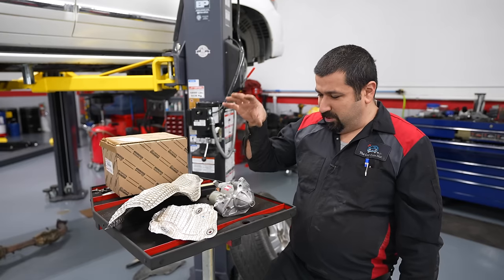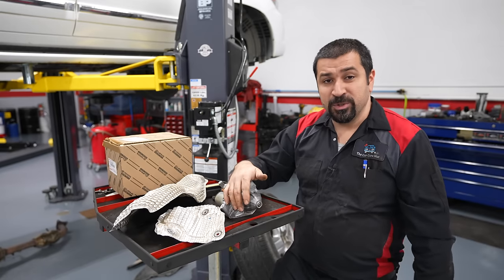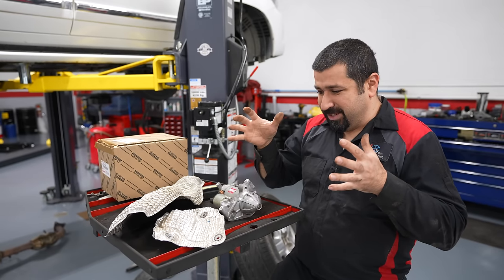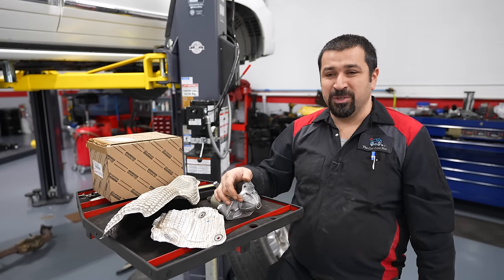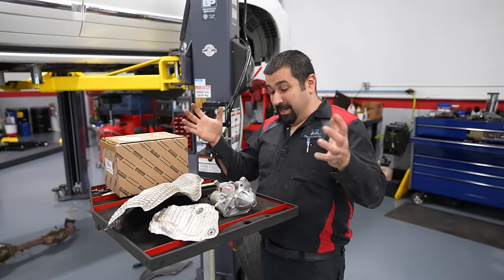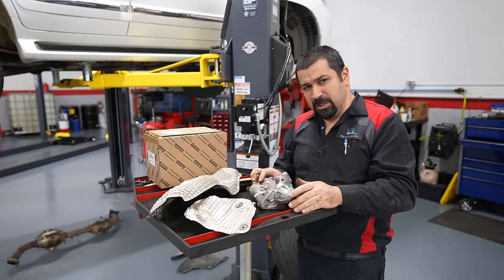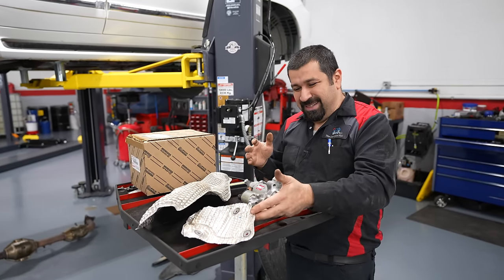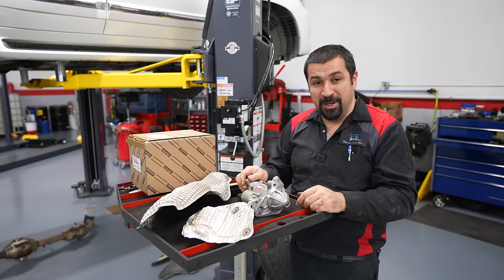This is possibly the worst job you will do on a V8 — aggravation-wise, not length-wise. Yeah, cam towers could be longer but they're not aggravating. This job requires extreme patience and a lot of time on tiny bolts — you can spend an hour just getting one bolt off. That's how bad this design is. The shield is really the worst thing, and the second worst is wrenching that top bolt out. This is where the problems start and it only goes downhill from there.